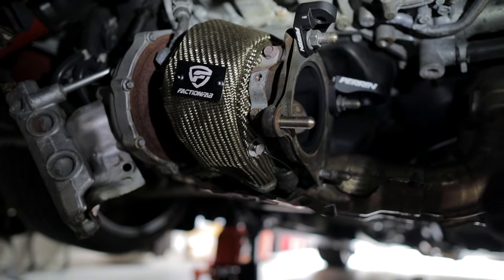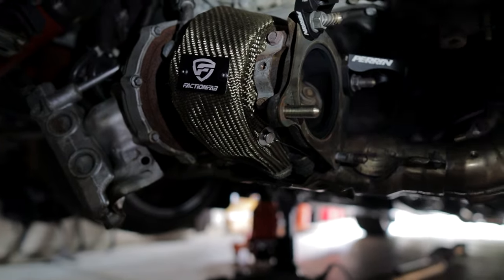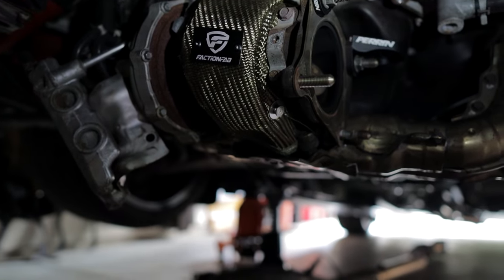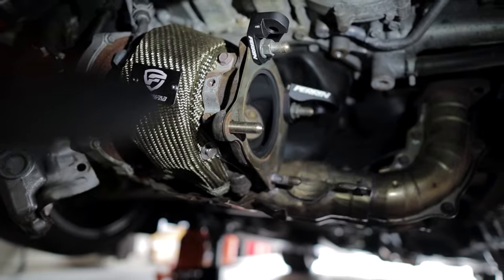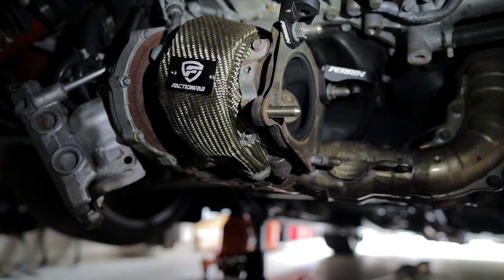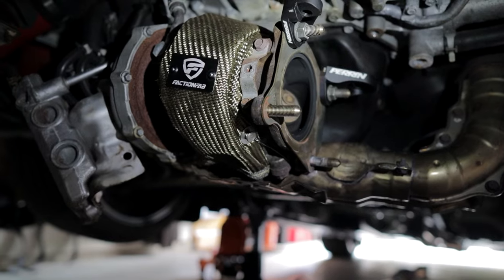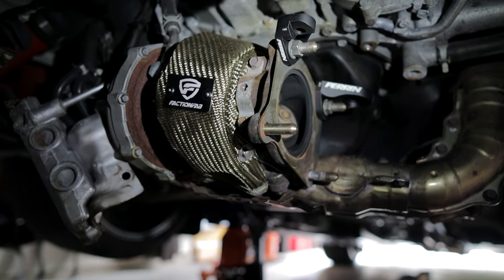I mocked up the two brackets just so you guys can see — I actually used that for the thumbnail. Now that the blanket is on, pretty much the last step is bolting everything back up in reverse order: heat shield back on, two nuts in the back, turbo sump comes back up, headers go back on, then the J pipe, and we're golden.